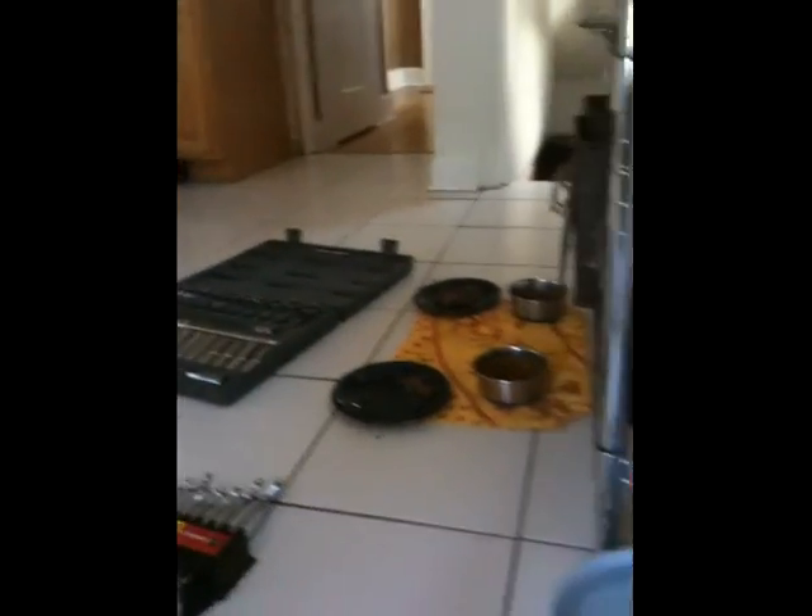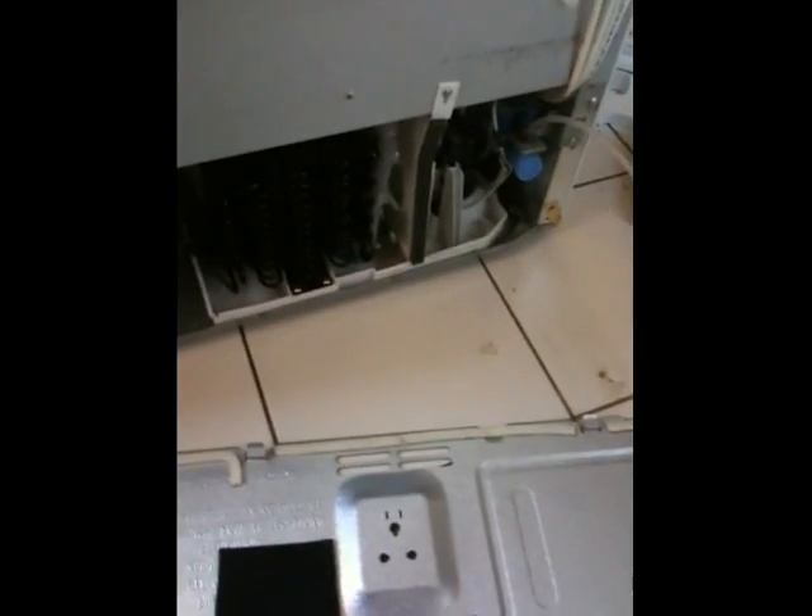We're moving to the back of the fridge. I've moved the fridge out, taken off the lower back panel, and put the screws to the side. The next step - I charged up my compressor with a blow tip, set it at a relatively low PSI because I don't want to damage anything, and I'm going to blow it all out and vacuum clean. Especially if you have little animals like we do - their hair gets in here and the blades are all gunked up.